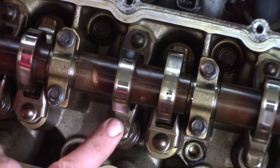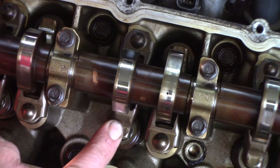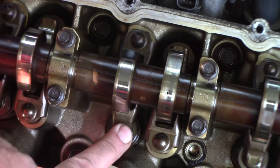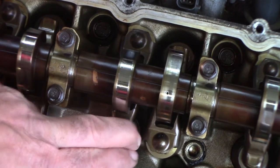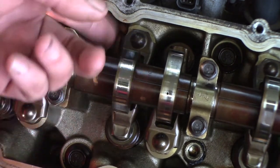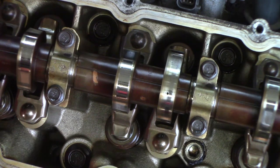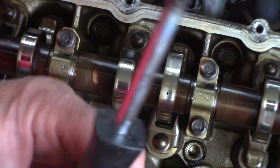I'm going to change the tone wheel on the crank - I got to pull the crank out. I'm going to change the wheel that's on the cam too. While I have the valve covers off, I'm going through and popping all these rockers out. One of the big drawbacks on these 4.7 Chrysler engines - and I imagine the 3.7 does the same thing - is that the rocker pops off and flops around, creating all kinds of damage and destroying the head. Then you've got to do a head job or pull the motor, and at this stage these things are getting old, you end up scrapping it.